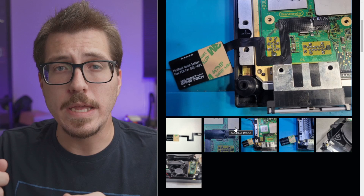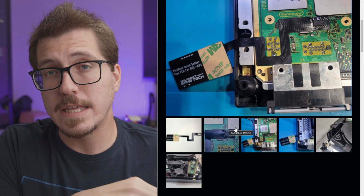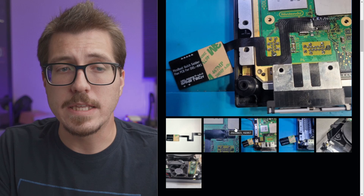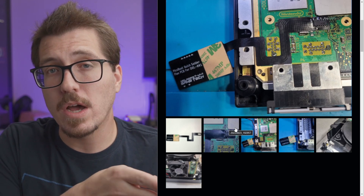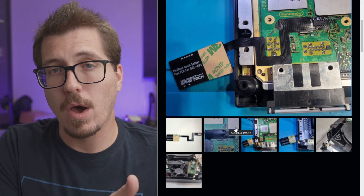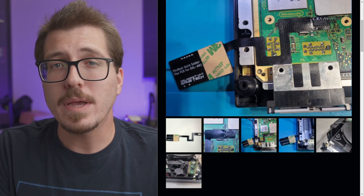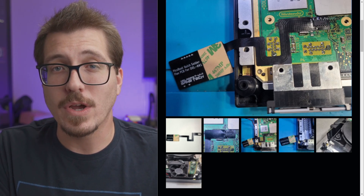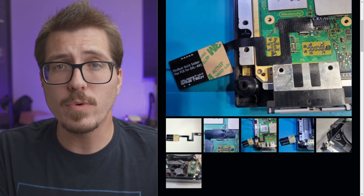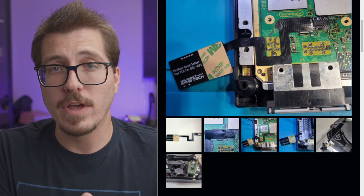When you plug the Raspberry Pi Pico in to update PicoBoot, the 3V will come back from the Raspberry Pi Pico into the GameCube even if the GameCube is not plugged in. I'm not necessarily sure how dangerous that is, but it's probably recommended to unsolder this if you want to update your Raspberry Pi Pico before the wiring is updated. Hopefully that doesn't sound too harsh — I love that mod creators are willing to support and create products for it. So if you're interested in flex cables for the PicoBoot for both 001 and 101 GameCubes, now there's another option available from Helder.